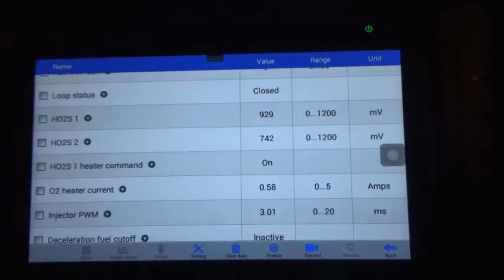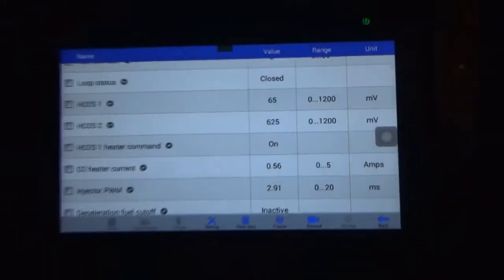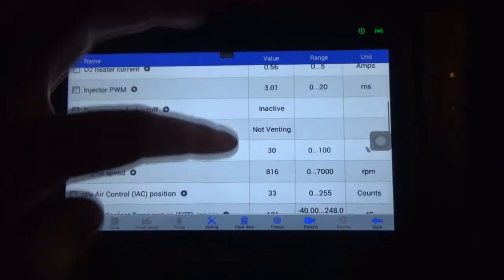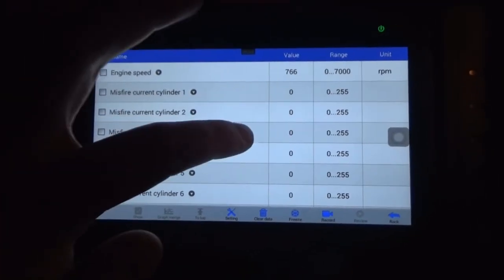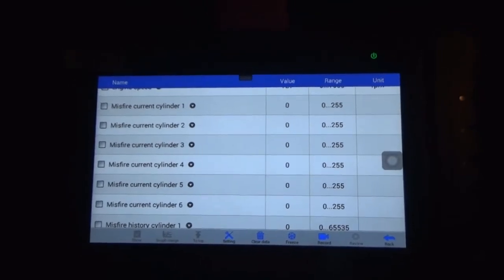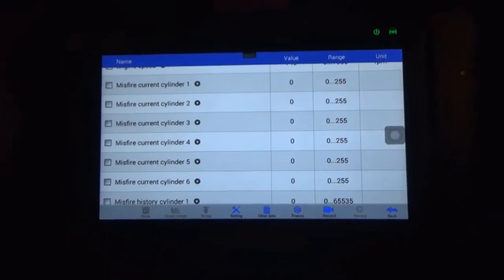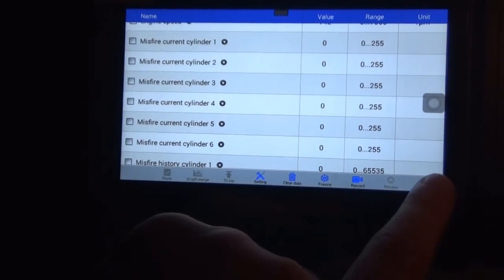These two things here, these oxygen sensors, those are changing almost at the same rate. Hence the inefficient cat. It's not missing. I thought last time I had a scan tool hooked up to this, one of these had like a miss every so often. Nothing crazy like the Aztec, but yeah, so far so good.